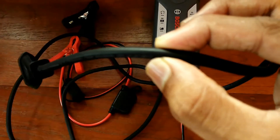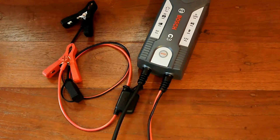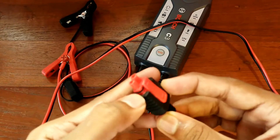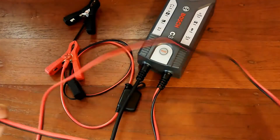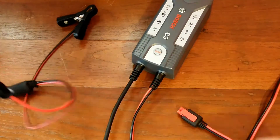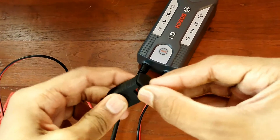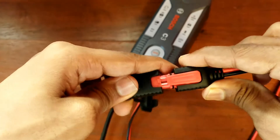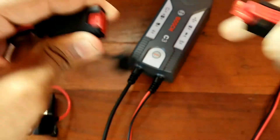It has one-button operation — just press the button and it senses the voltage and charges automatically. In a normal situation the charger switches to standby mode. If there is a loose contact or poor connection, the charger senses it and automatically stops charging, which does not allow the battery to be overcharged. If you charge your motorcycle battery and select motorcycle mode, it is safe. When the battery is fully charged, the charger will automatically cut off, go to OK position, and charging stops. When it drops below 12.8 volts it automatically goes to trickle charging mode, keeping your battery safe.